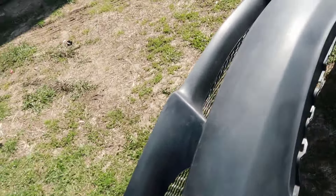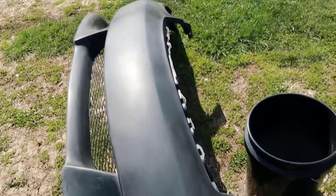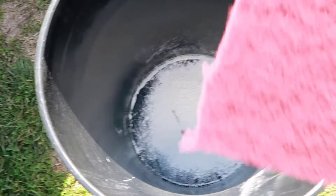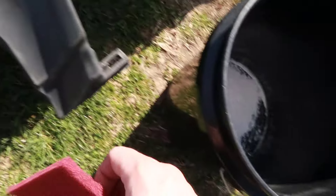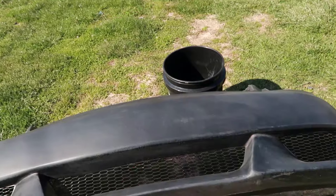Now for this — they usually come primed from the factory, but the primer's really not all that great before paint, from what I've seen. You can use some Ajax — yeah, like wash cleaning stuff — and some Scotch Brite. I don't think they recommend this color; they recommend like a gray one, but I'm going to use this one anyway since it's what I got. You just want to go across the whole bumper and take the shine off — see how it's shiny? You want to have it all dull, and then you'll be able to prime it. Let's see how it goes.